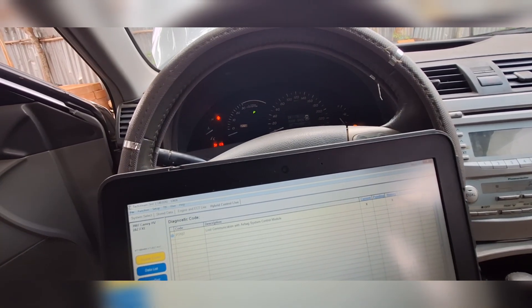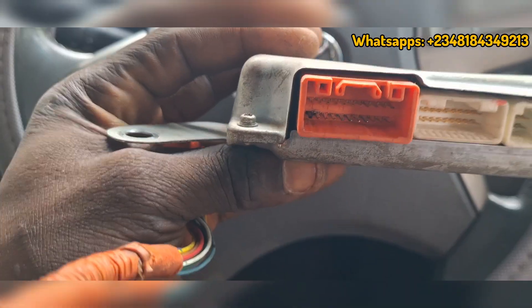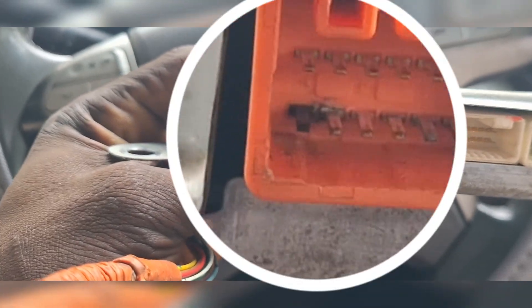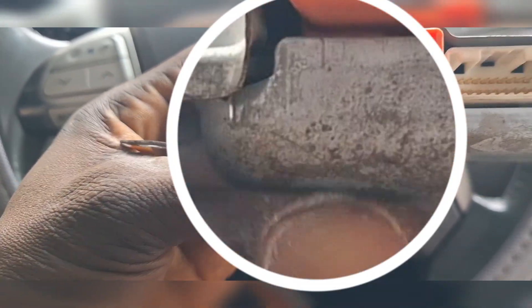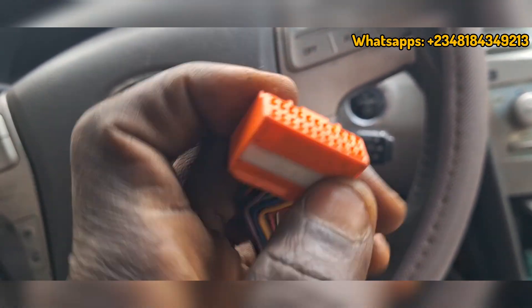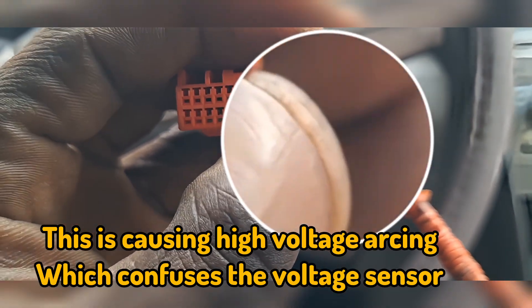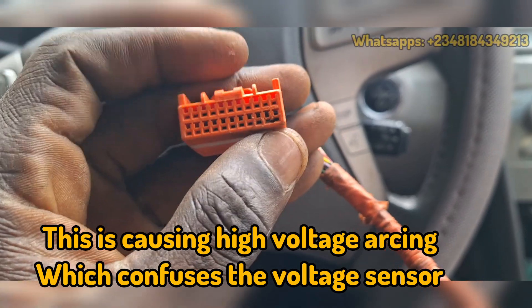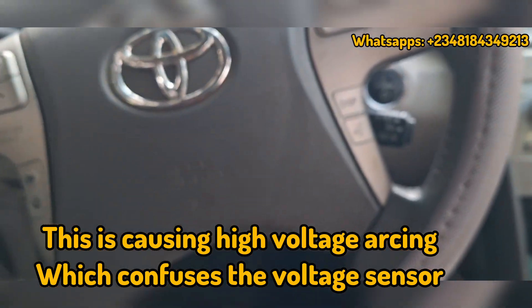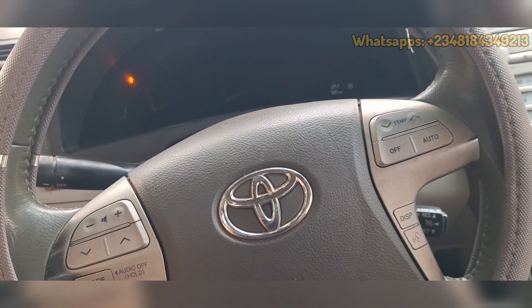Because of the battery block one anomaly, I went ahead and replaced the battery ECU. Looking down at the connector around the terminals, it's a bit burnt up — and the connector has the same burn markings on it. There should be two pins here but they're joined together — burnt. I think this is what was making block one misbehave. I'm going to start the car now and see if we have good reports. That voltage fluctuation was not giving me confidence, so I had to replace it.